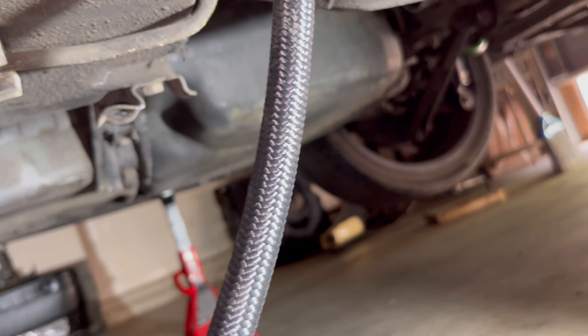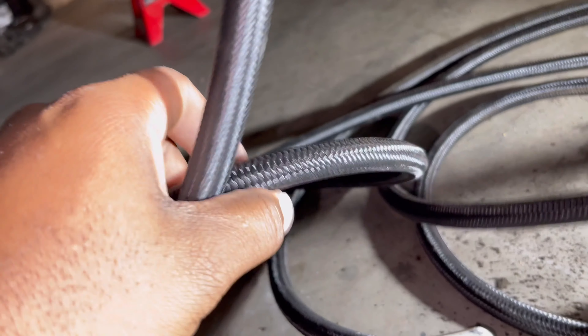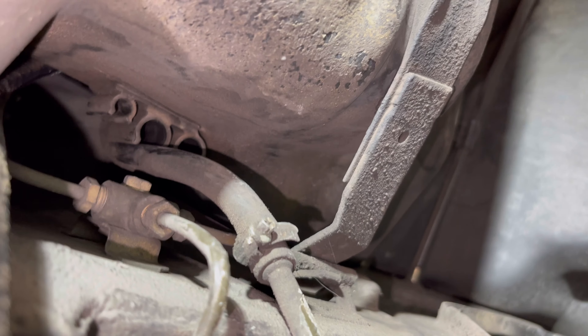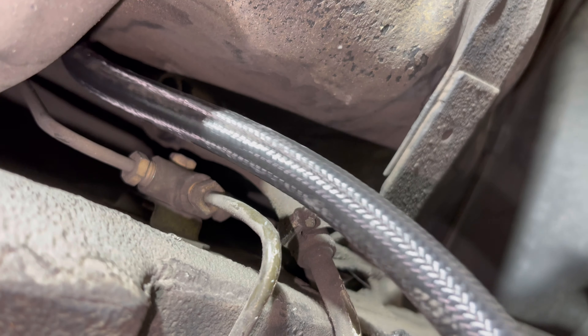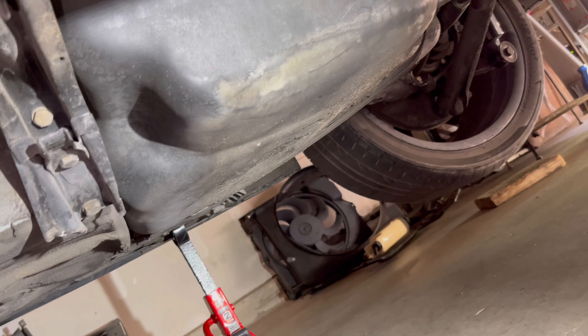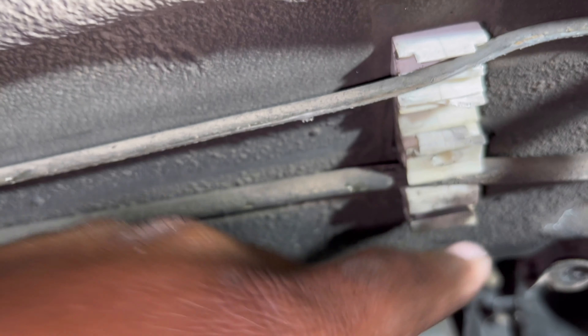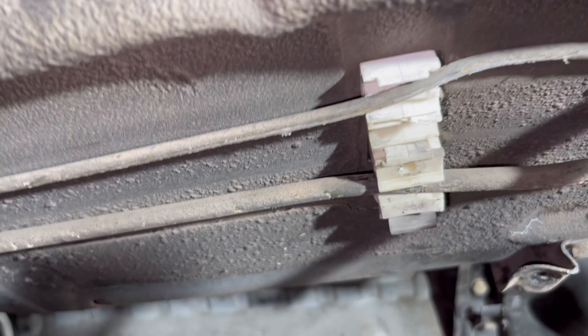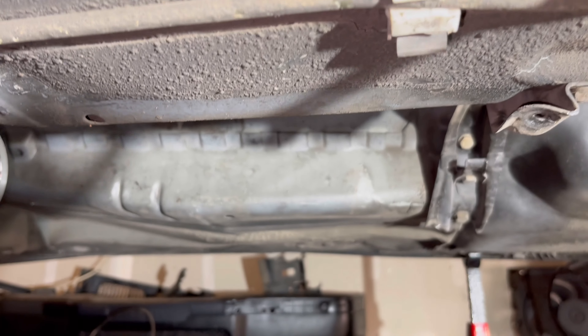Back under the car — here's the bulk of the line, it's all out. Make sure you cross over to the driver's side because there's an actual section for the hose to come out. You don't want to come out through the middle because the drive shaft is there. You can even use the OEM mounts. I'm going to clearance them to fit, remove the return line and make my own out of the excess -6AN line.